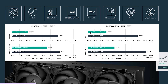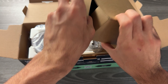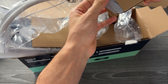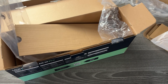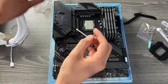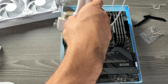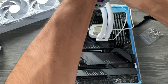Right off the bat, opening up the packaging you can see it's basically already built — the fans are pre-mounted, so it's going to take two minutes to mount it on top as an exhaust, which is where you should put it basically all the time if you can. On Intel socket you'll need to remove the stock bracket, put on the plate, screw it down, and then it's just two screws for the actual pump. You can use the included MX6 thermal paste — it's actually the paste I recommend and use in 90% of my builds.